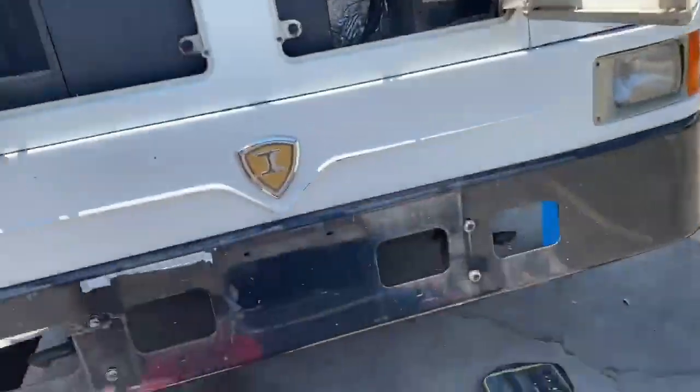We just finished taking out the hose lines for the radiator, heaters, and coolant. We ended up draining five gallons out of the hoses and heaters. After doing the re-loop on the coolant lines, I forgot to open them back up, so when I started the bus we got a warning light. First lesson: open those lines back up after doing the loop-back. Second, we drained five gallons and didn't account for that. After opening the valves back up the bus was still alarming, then we remembered the five gallons — so we got two more gallons of coolant, filled it up, started the bus, and everything's working fine. Heaters are 100% done and checked off the list.